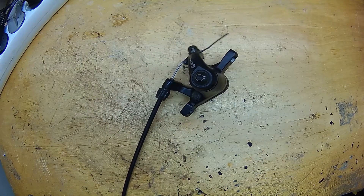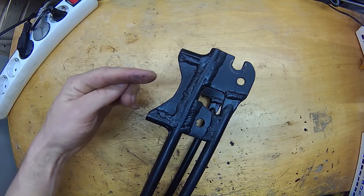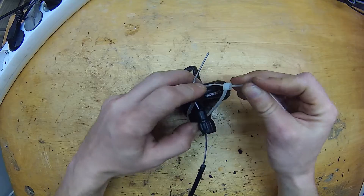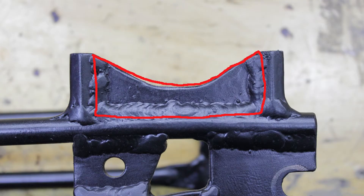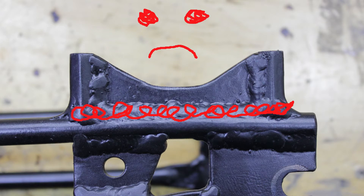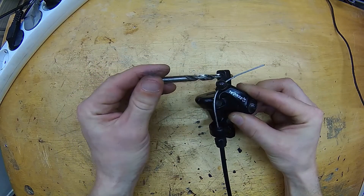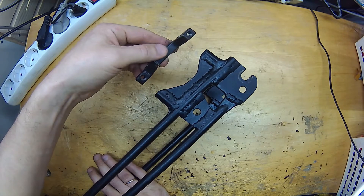It's a good idea to have front brakes. On this project I wanted some regular disc brakes, so I needed to create a mounting point for a caliper. I took a couple of M6 tie bar connectors, welded those to a piece of metal, and created a bracket. Then I connected the caliper to this bracket, placed it on the disc, pressed the caliper shut with a zip tie, and tacked the bracket in place. Next I made a stupid mistake — I thought removing the caliper for final welding would keep the structure in shape. The heat made the tube bend and the distance between bolt holes changed. I was lazy and decided not to redo it, so I took a drill and made the holes on the caliper a little bit bigger. To avoid this mistake, I should have kept an adapter attached to the bracket while welding.